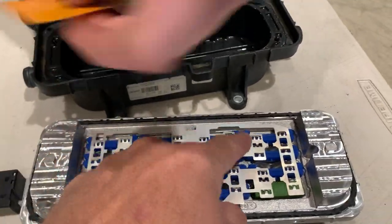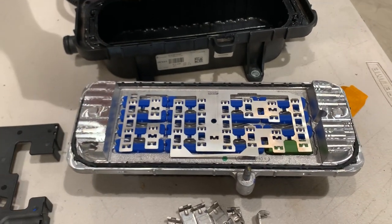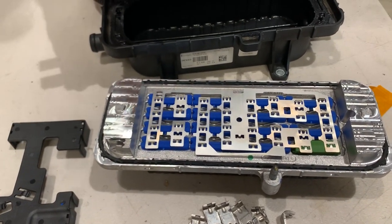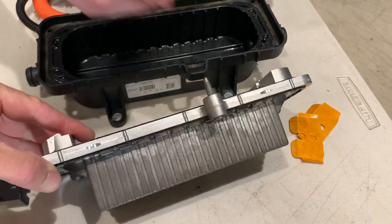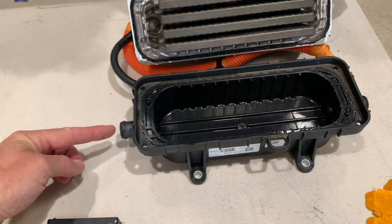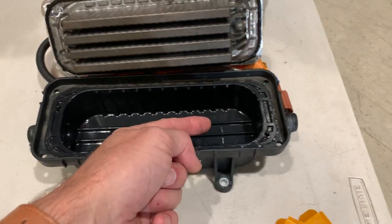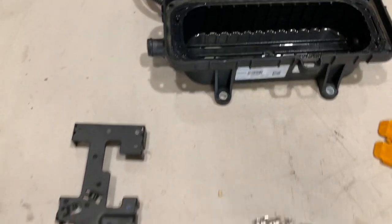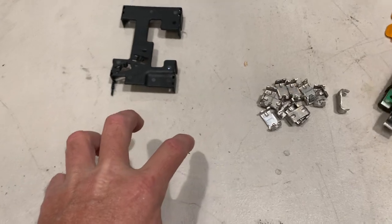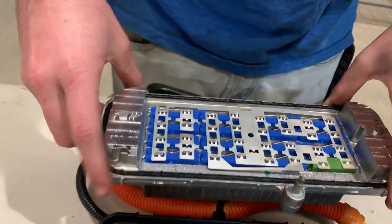This entire piece is aluminum, so it's a giant heat sink that the heaters will heat up. When you flip this over you can see that the coolant comes in on this end — it literally flows through this little tray, comes out the other end — and there's a pump located over here in the car.